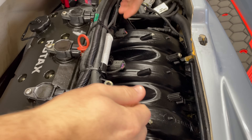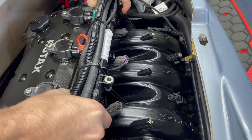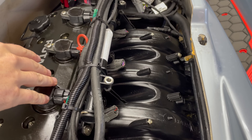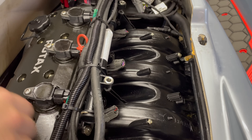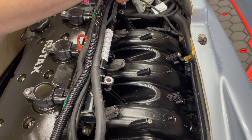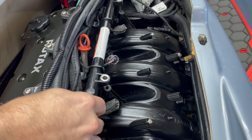Next I'm going to go ahead and just gently pull up on the fuel rail to remove the fuel injectors. Just to give myself a little bit more room to work with, I'm going to go ahead and cut the zip ties on here. If your ski is stock, you most likely will not need to do this. I did a wiring cleanup on my ski about a year ago, so I really tightened things up in here, which removed a lot of the room and leeway that things had. So now the fuel rail will just lift right up like so.